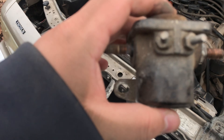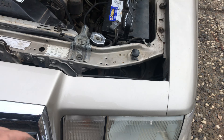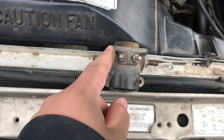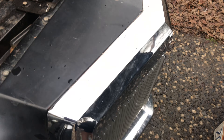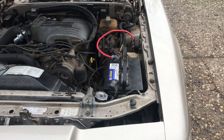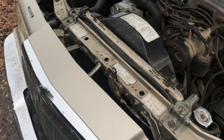Here's a better representation of a solenoid — or, because it's a Ford, it's a relay. It's going to be sitting like that in the car. You take your screwdriver, touch these two together right here — basically you're just completing the circuit, car is going, and there you go. Super, super, super simple.